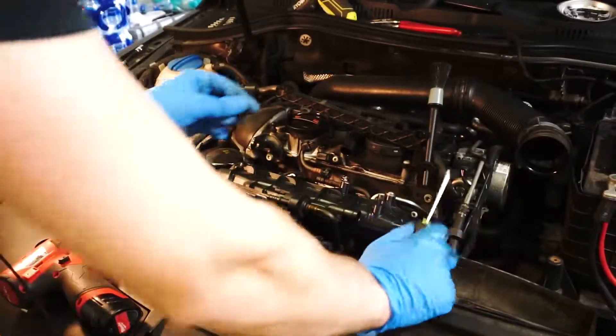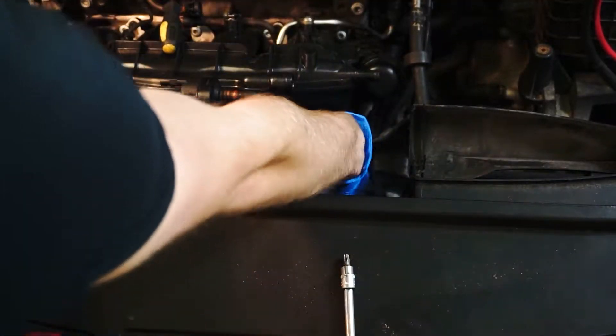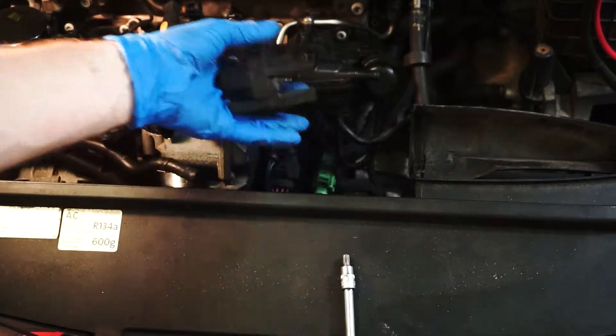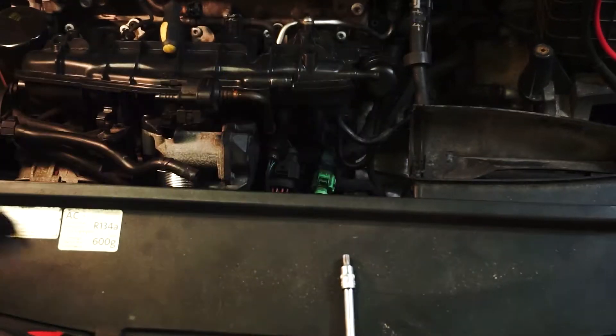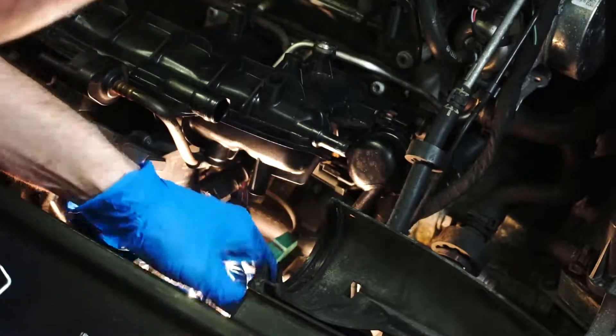You've got to remove both of those, as well as a plastic bracket holding all three connectors. What I did: I unbolted it — it was just two or three T30s holding it mounted — and basically you slide out all those connectors and set it aside. The last thing is removing the solenoid. I already broke it, so I'll put it back in. I believe those are T30s.